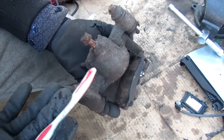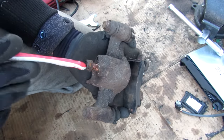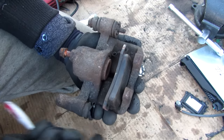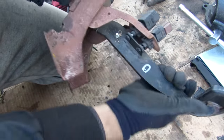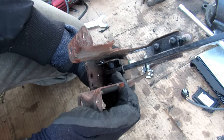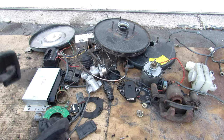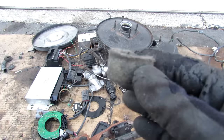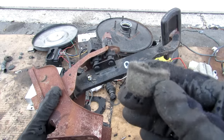The calipers ultimately do most of the work — their operation is simple: hydraulic fluid goes in, pops a piston out to squish the pad against the rotor and stop the wheel. The brake pedal has two stoplight switches, is a giant arm that multiplies force, and has a return spring inside. The next time you stomp on your brakes, think of all these components. Remember to change your air filters often, and follow along for more videos.